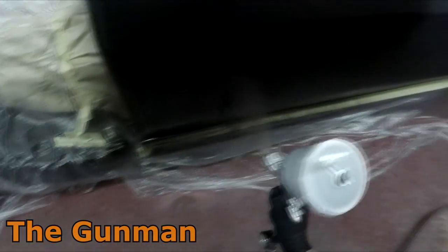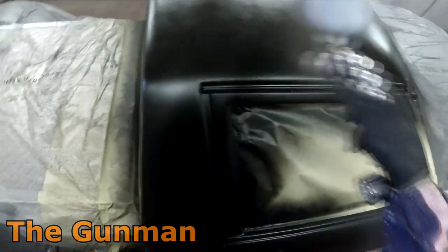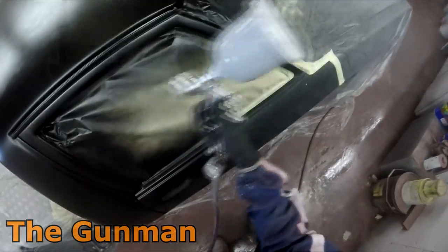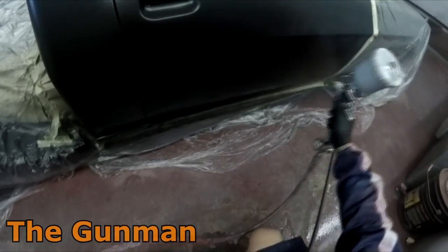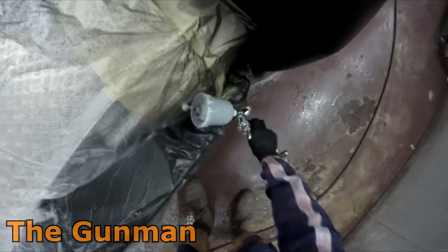This GPI — when the original GTI Pro came out, spray guns really changed for me. I was never a big Sata fan, although some of those older Satas were quite good — the NR2000 was an absolutely awesome gun. I never used the 3000 but I hear that's good. I didn't really like the Sata Jet 4000, but the 5000 is an absolutely amazing gun. If you look at the diameter of the air cap, they're much bigger than the older guns like the FLG5 or the SGK. The size of the air cap makes the fan a lot bigger — that's where it's really changed in my career. Now they've re-released it as the GPI, anyone can afford it.